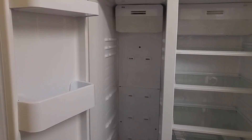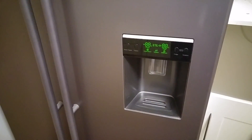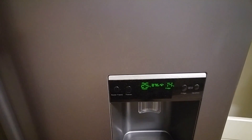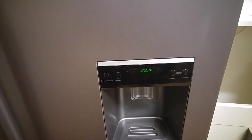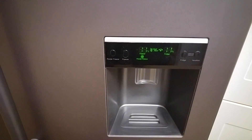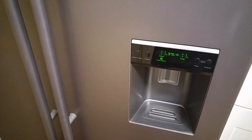Let's power it up and see if it's working. We're powering up and there are no error segments. We've got the temperature displays. The freezer is showing hotter because I've had the door open and it is actually really hot at the minute, whereas the fridge is cooler. It looks like it's firing up fine. Just checking the light's coming on - and it is. So it looks like everything's working. I'm going to leave this to cool down now. It's been running for a few minutes - let's have a quick check on the temperature. There we go - 11 degrees. It's dropping the temperature down nicely, and hopefully within the next hour or two it should be down to the normal temperature.